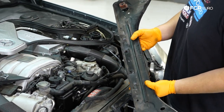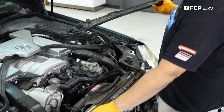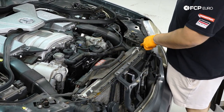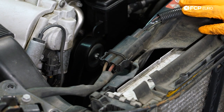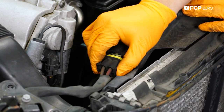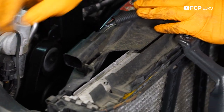Make sure when you reinstall this later that both rubber grommets are secured and lock back on top of your radiator — that's what keeps everything in place from moving around. We'll set this to the side and continue on the fan shroud removal. Next, disconnect the electrical connector that leads to the electric fan by pushing on either tab and pulling the connector back. Tuck that behind the ducting and leave it out of the way.